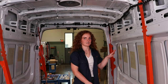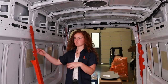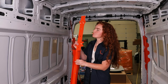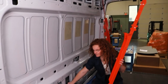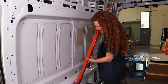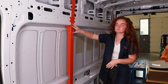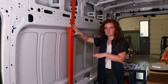Now that we've set the bracers on the driver's side, we're going to go over to the passenger side. These pieces are going to be pretty much identical and use the same indexing points, just a mirror image. The first piece we're going to put in is TX 3.5 — this has those little plastic tabs on the back as well, one right under the label and one way down at the bottom. Those are going to slip into two factory holes — one here and one right at the crest of the wheel well. You might have to slip it under the wheel well cover like we did on the other side. I'm going to put some set screws in and then do the same exact process as the other side — drilling holes, setting rib nuts, rivets, rust prevention.